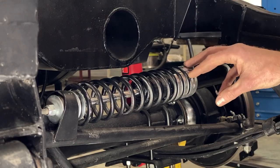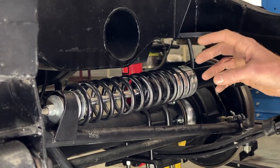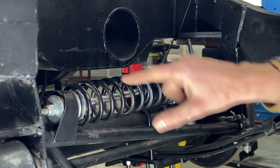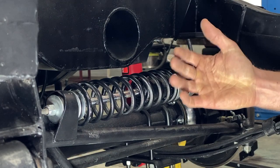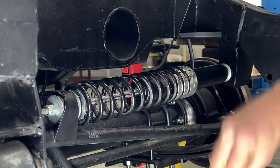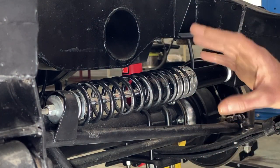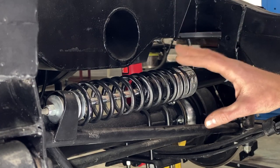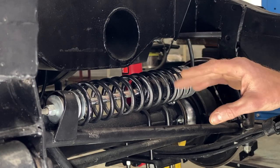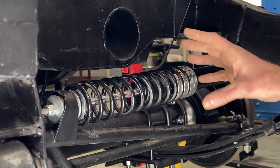This is the return to center steering dampener we put on the cars. And a steering dampener is really just a shock absorber for the steering system. The return to center element that is a bit unusual is this spring. So you turn to the left, it compresses, you turn to the right, it expands, and of course it wants to then pull itself back into a neutral or straight ahead position. A steering dampener like this, a return to center one, has been used sometimes to mask steering issues, vibrations, misalignments, other issues within the steering system. But when used correctly, it's really nice.